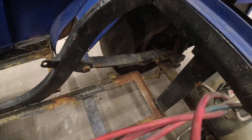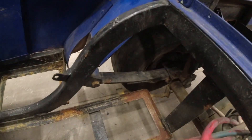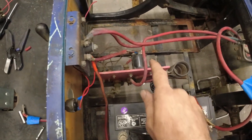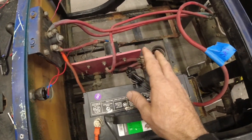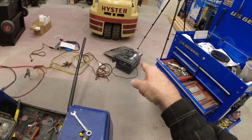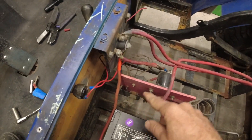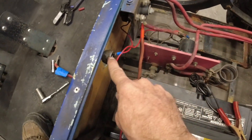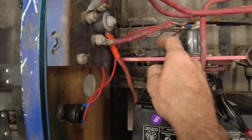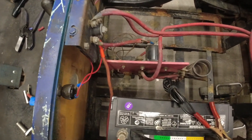It works just fine — the tires are moving backwards, flip that, and the tires are moving forward. We've got everything working, albeit on 12 volts. We're not quite out of the woods yet because we still have to figure out what to do with the solenoid. The fact that it's stuck in the on position is actually good for testing because it bypasses all our safety switches, but we are going to want those safety switches once we put in our better battery pack.